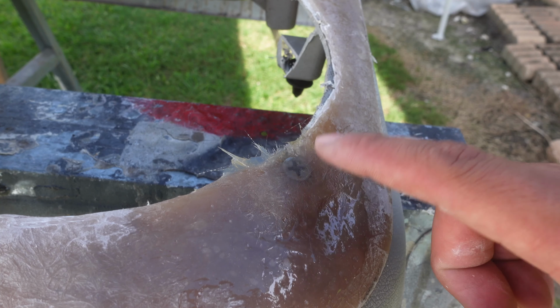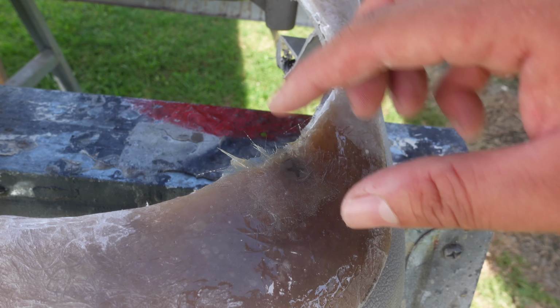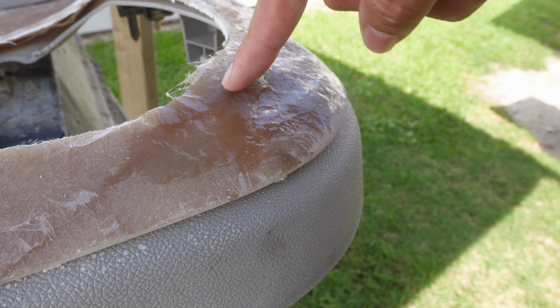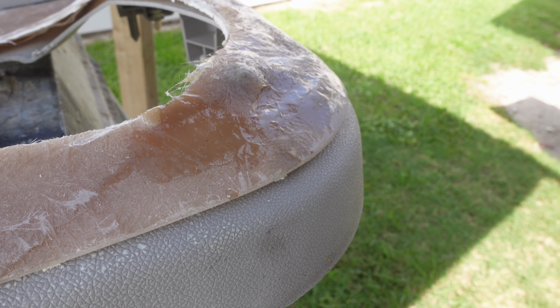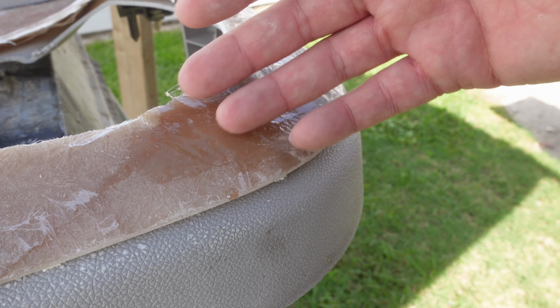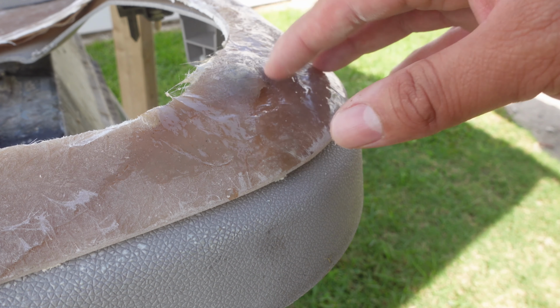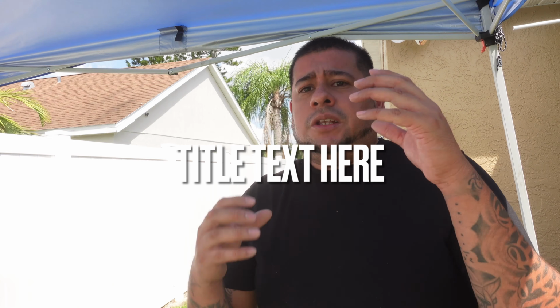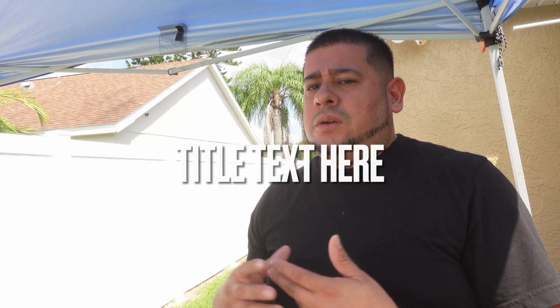And yesterday as well, we went ahead and did our mounting points. We drilled some holes, countersunk them, and then we put some bolts through with some fiberglass and laid some fiberglass resin on top of it to secure the door panel. Now we have some thread so we can put a nut on it once the door panels are done, to secure them from ever falling or sagging or any of that type of stuff.